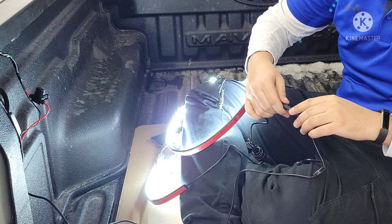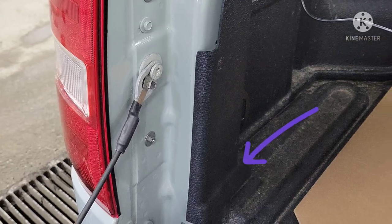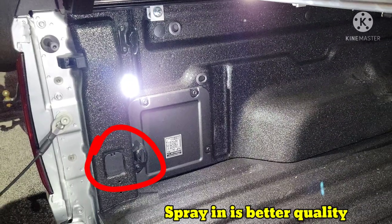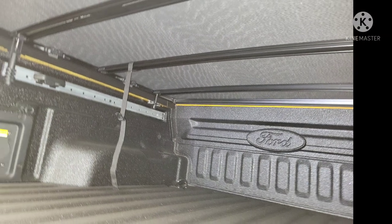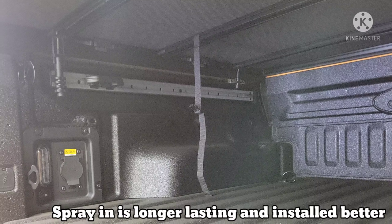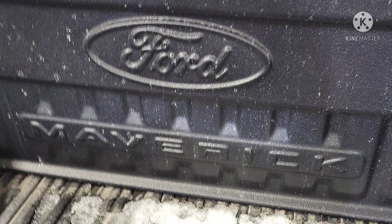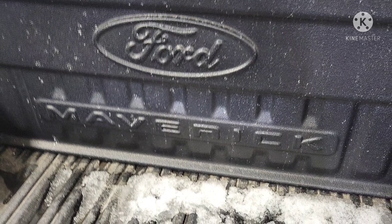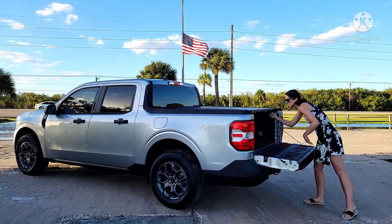If you are thinking about beds, keep in mind plastic is a little less expensive than getting a spray-in aftermarket. However, the plastic drop-in will cover your accessory electronic wiring in the back. So if you plan on wiring up your own LEDs, just keep in mind you're either cutting out that little hole for the accessory wire. The plastic is also less durable — if you throw in something like a skidoo, it'll rip right through. Line-X has far more grip and is longer lasting, but once you get a stain in it, it's also going to last there, and it scratches — so you can't just pull it out and replace it.